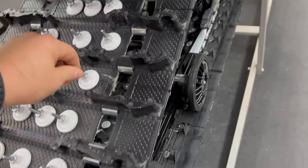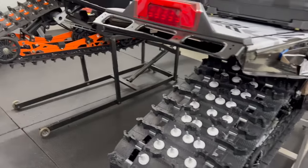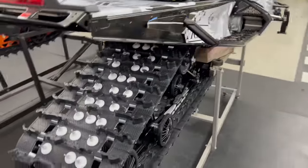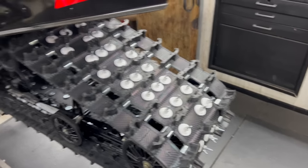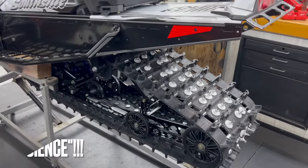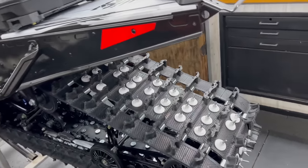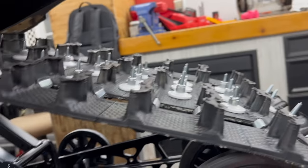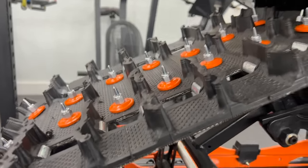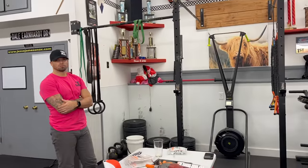It's a lot of work — 153 on my sled and 96 on Neato's — but it's much better than potentially pulling out a stud because it came loose. I never thought about it that way until working with Woody's. It's just like air pressure — anything cold shrinks — so you've got to go back through and re-torque. I'm running the 1.45s with about a half inch penetration; Neato has the 1.325s on his one-and-a-quarter inch track.